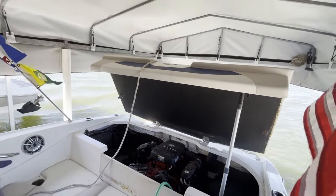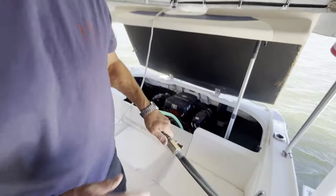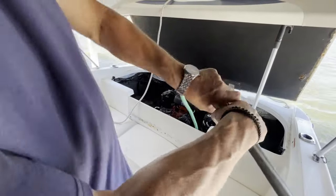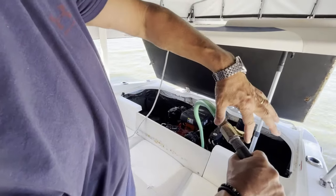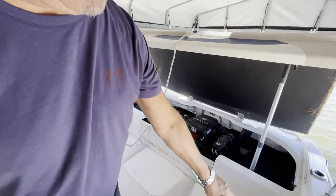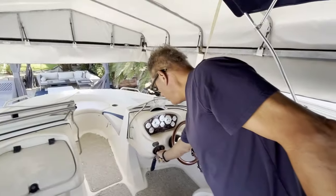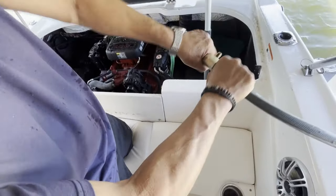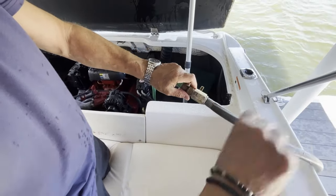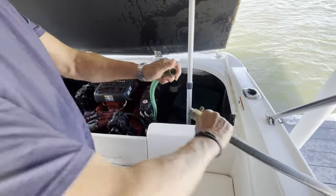Let's pretend two minutes are up. What we're going to do is first starve the engine of water by turning this valve off. If we just turned the engine off and then disconnected the hose, it would have a lot of water pressure and squirt everywhere. So we turn the valve off — bearing in mind the engine is now no longer getting any coolant water — then we turn the engine off. With the engine off we disconnect the hose; the valve is perpendicular to the pipe. We turned off the valve, then shut off the engine, and now we're disconnecting the hose.